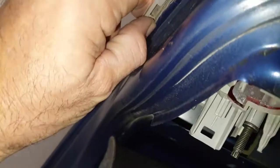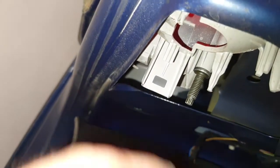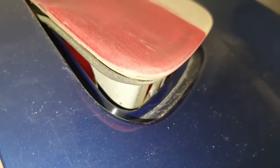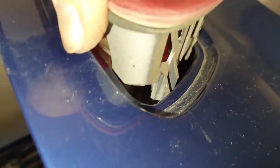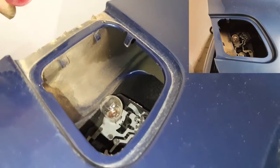You may want to keep the original bulb housing and use it with the new light — check your kit as they don't always come with the bulb housing. This part is a little fiddly because it has pressure holding it in place with the plastic bracket, and it's on an angle, so just jiggle it out. Lift it up and push it out. Clean that part of the boot lid before fitting the new light.